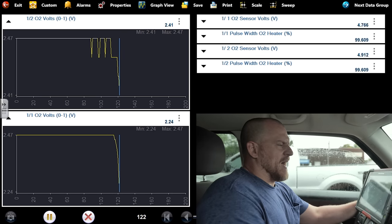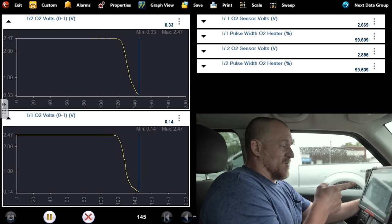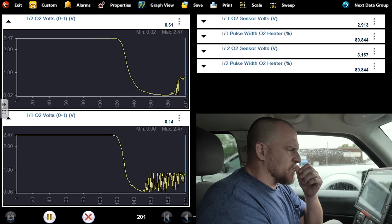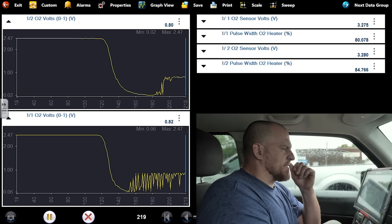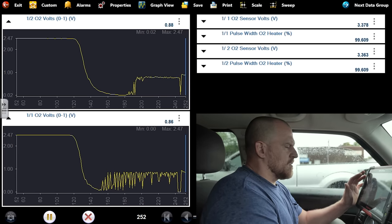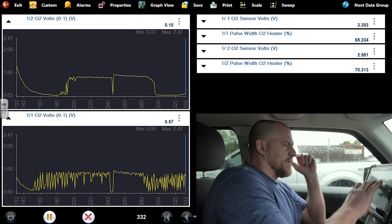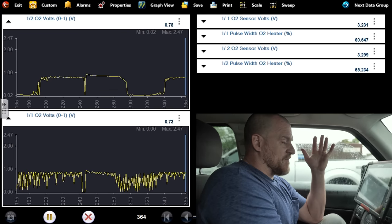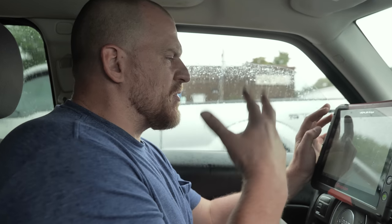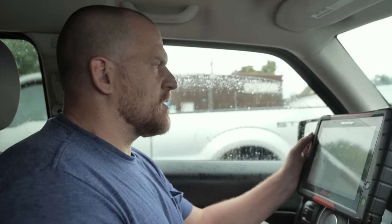Real bad misfire right off the bat. I'm not really worried about the O2s - the O2 warmed up really fast. I'm not overly concerned about the O2 heater or sensor at this time. We're going to attack the misfire. It's possible that the upstream sensor could be faulty and contaminated. Danner was saying he saw something with the injectors where it wasn't even commanding the pulse width on one of the injectors - that's what I wanted to look at.